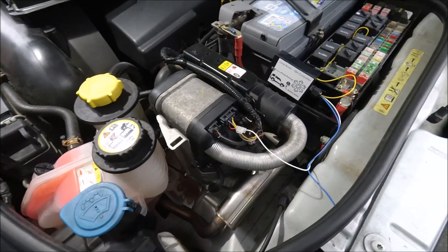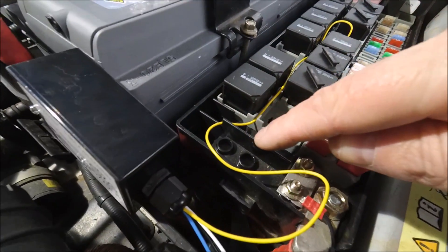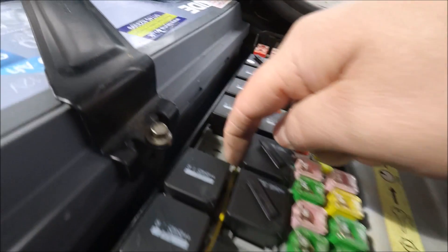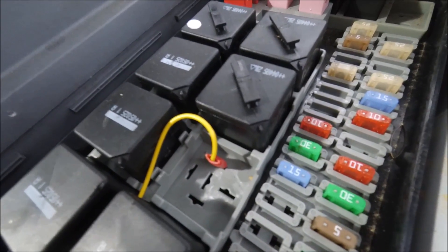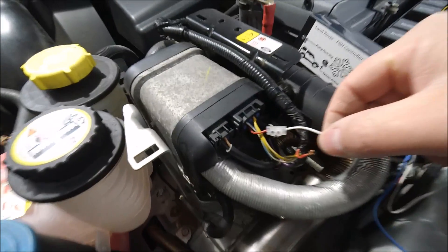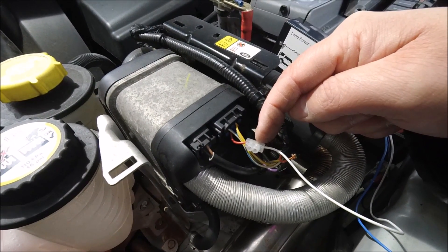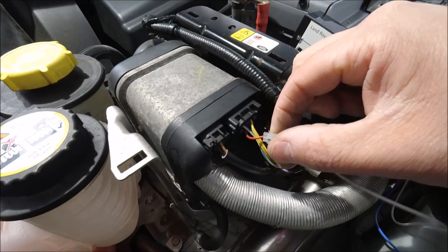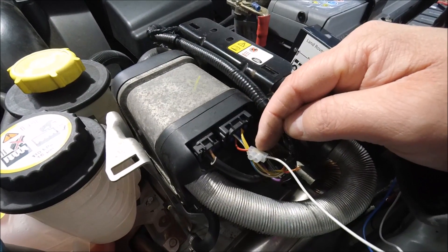The controller has been installed now. To summarise: the yellow wire feeds up through the groove around the plastic and up the middle of the relays — there's actually a little clip there almost made for the job to hold the wire in. Then fit your red crimp onto the top terminal of the unused relay base. The white wire follows around — keep all wires away from the exhaust — and that joins onto your red wire coming from the heating controller. You'd probably want to solder and heat shrink it, or use the inline crimp supplied. I've used a quick release chocolate block connector here because I'm always taking this off for testing purposes. Also if you buy one of the Webasto Diagnostic Interface cables, that also connects to this terminal, so you may want to make that a removable terminal.